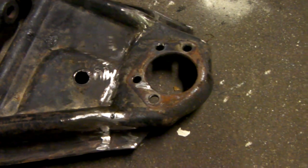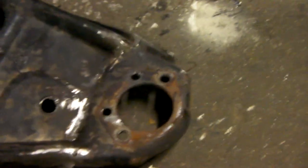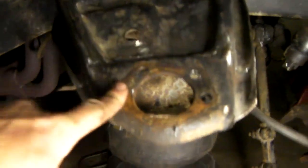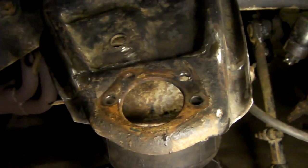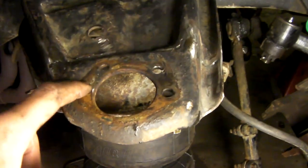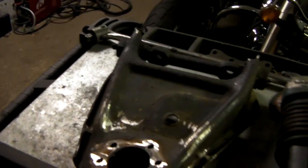I got the first upper ball joint removed — let's just call that mission 'easier said than done.' You just grind the rivets off and the ball joint should pop right out. But these little remaining factory rivets wedged in there after 45 years — I had to do a lot to get those things out. Pretty much had to heat it and beat it. Both sides upper ball joints are removed. What a pain in the ass that was. I thought the lower ones were going to be a nightmare — not so much. These uppers were a pain in the ass. I had to grind them flush with the top of the control arm, put the torch on them until they were scorching red, and just beat the hell out of them. Finally was able to get them to pop through.